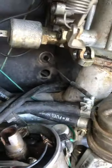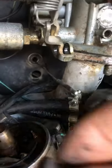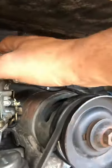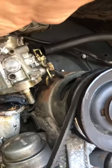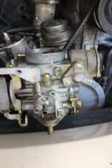I undo the bolts with the pliers whilst holding the throttle cable, but obviously you could just use a spanner — it's probably about 8mm. So then that should all be loose. Sometimes the loom runs past the carb. Obviously there is a gasket in here; I don't know what condition it's in. The loom's in the way there, so I just lift the loom over it.